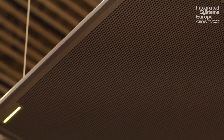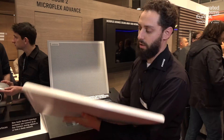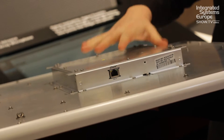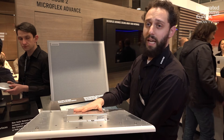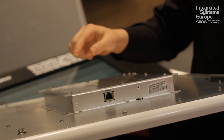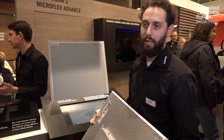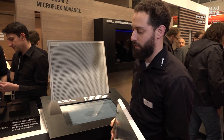In terms of the actual connectivity for this microphone, it's got a single Ethernet connector. This is a Dante microphone — all the new Microflex Advance products are all based around Dante audio. It's powered by Power over Ethernet, so one cable handles your control, your audio, and your power. It can also be controlled via third-party control systems using standard Ethernet commands, so you can have your touch panel talk to this microphone as well.